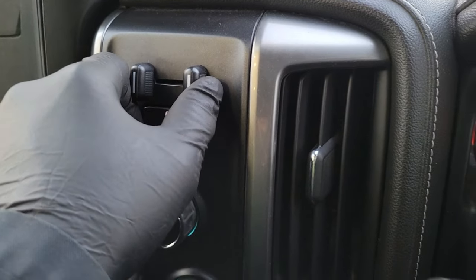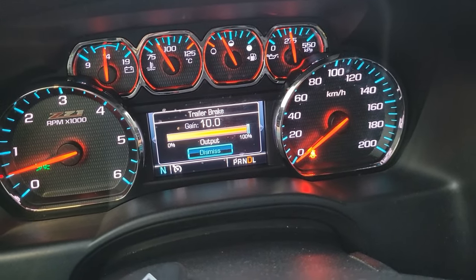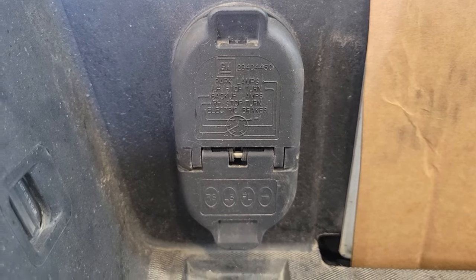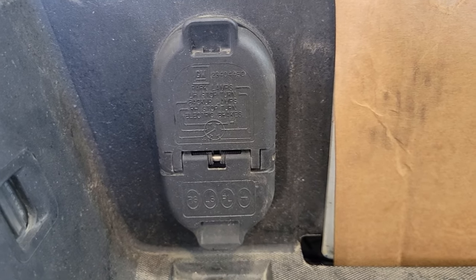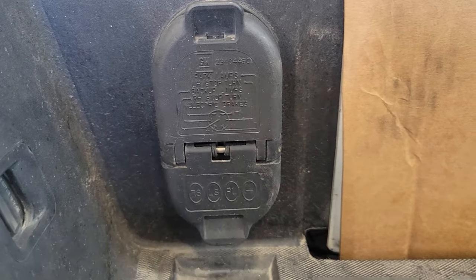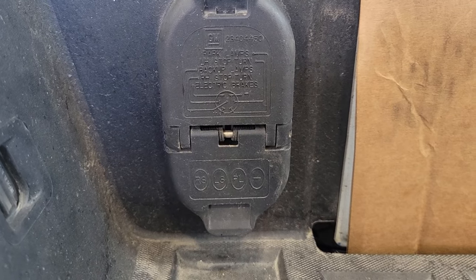As you roll ahead and apply the trailer brake, you'll see it in your instrument cluster — you'll know it's working. Like I said, nine times out of ten with that code and that warning, the problem is with the trailer brake power. But if you have a problem with any of these, go into the engine compartment and start checking your fuses.